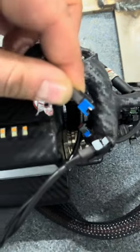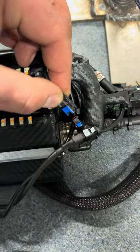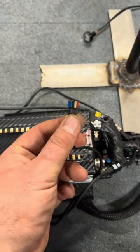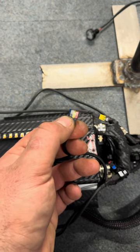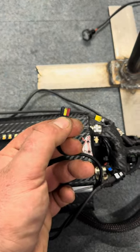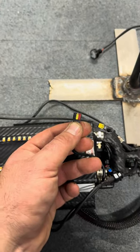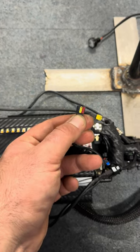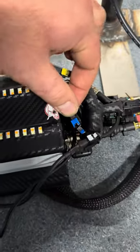You have the male plug and the female plug, so you know blue goes with blue. There's also a color code label for each wire showing where it goes. For example, black is the negative at 72 volts. The yellow one goes to the controllers — I believe it's number seven on the controllers — which activates them. Red is positive at 72 volts. They are very easy to connect.